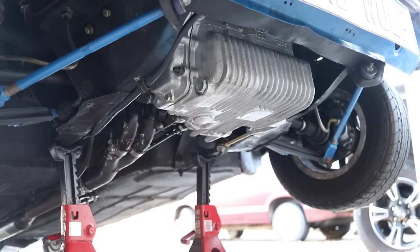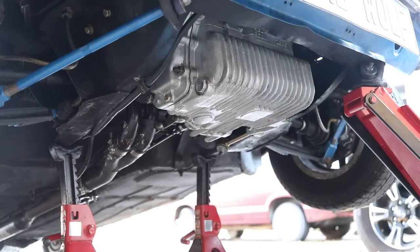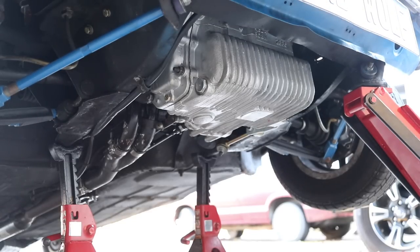One thing you absolutely must do when working on your car is always, always use jack stands if you're underneath it. These jack stands are not expensive — you can get a pair for about $15 on Amazon, I'll put the link in the description. These will absolutely save your life. Now I've moved my jack back to one of the mounting points. There are effectively three points of failure on this car when it's up in the air: your two rear jack stand mounts, and I'll often leave my jack itself underneath the first mounting point — not with full tension, but tightened and just touching it. That provides three points of safety. If any one fails, you have enough time to get out from underneath before a second or third one would fail. That's the front side of the car — let's lower it back down and move to the rear subframe.